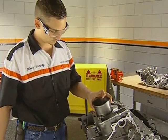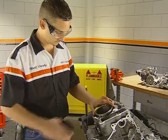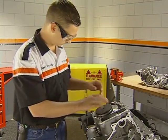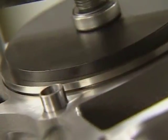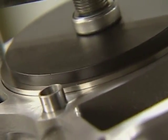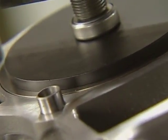Insert the liner in the case with the assembly plug on the liner. The cross brace and screw can now be positioned and attached to the case. Press the liner in until the flange seats and is level with the case surface.